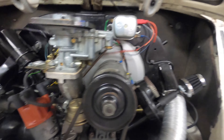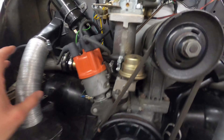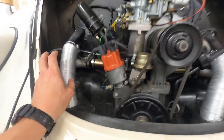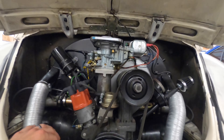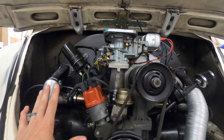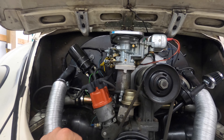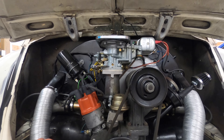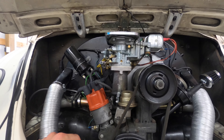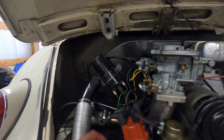Get rid of that cable running over here and disconnect it. You also need to disconnect the fresh air tubes so you can get this panel off — there are just a few screws in this panel. That way, when you disconnect the engine, you can push the engine towards you past that piece of sheet metal. After that, I'll go over the four bolts mounting to the transmission.